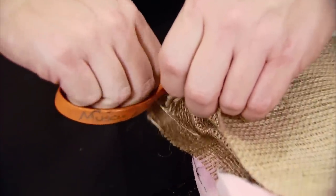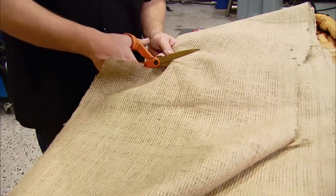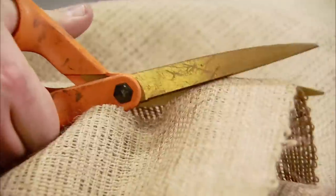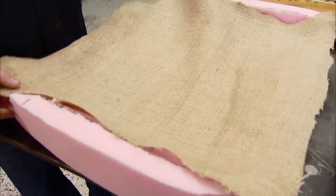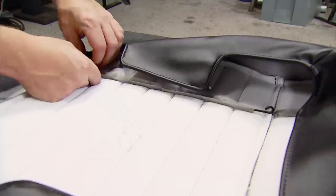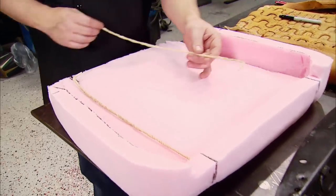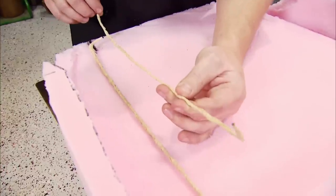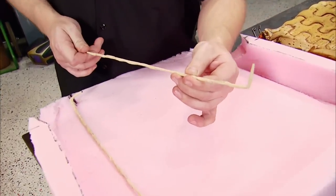The original seat had some webbing made into it, so since we're using something a little different, I'm going to use some burlap to reinforce those rods. A little Loctite spray adhesive will hold the burlap in place. I'll grab the new covers and poke the rods through the little channels where they hold the cover onto the foam. Now originally these rods were wrapped with an adhesive paper, so we went ahead and wrapped them with some masking tape — whenever you clamp a hog ring around it, it gives it something to bite to, other than just sliding around on the rod.